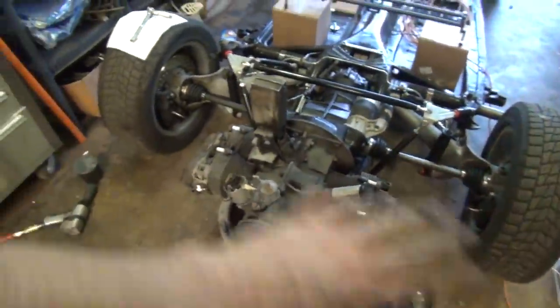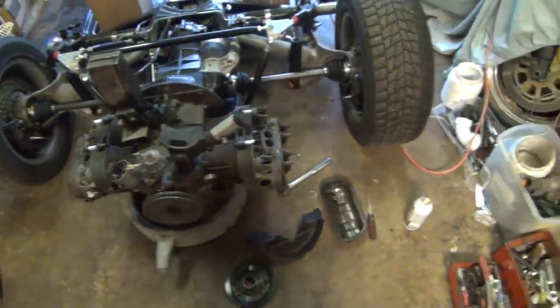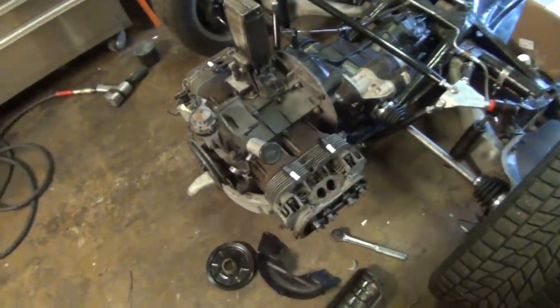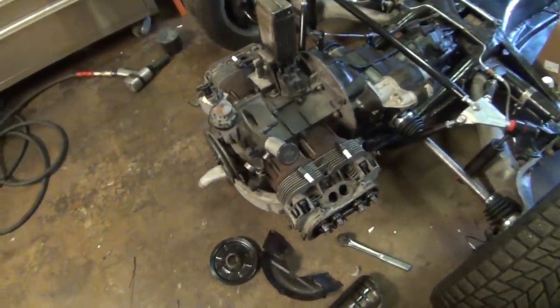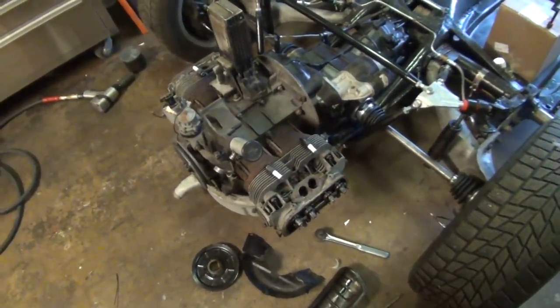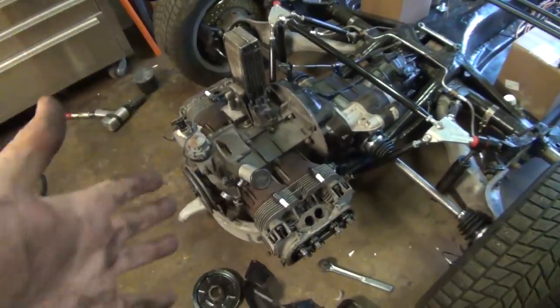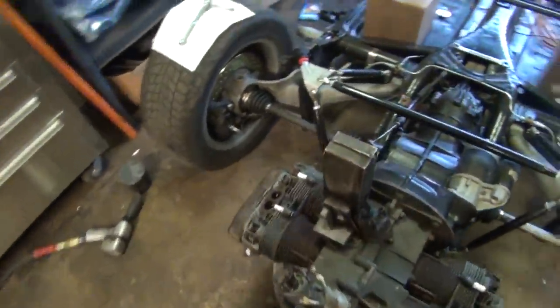And from sitting underneath that bench, seeing as how this engine was just covered in a layer of sand dropped on it, that was highly concerning. So I started to pull some of the paper out, and I discovered that some of the sand actually found its way down into the intake port. The good news is the engine has not been running. So the only sand that may have gone in was into cylinder number 3. That was the only valve that was open.